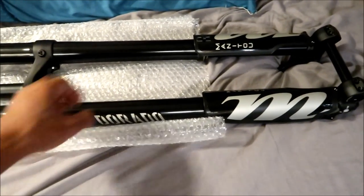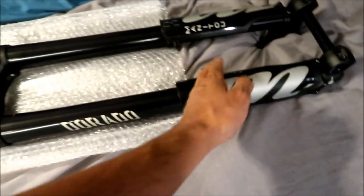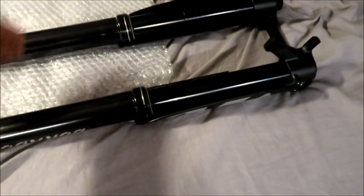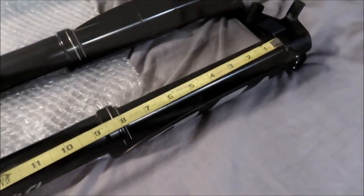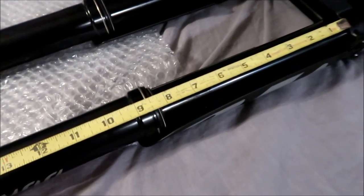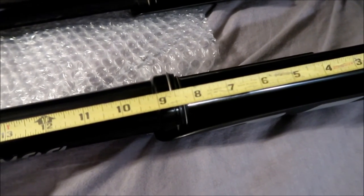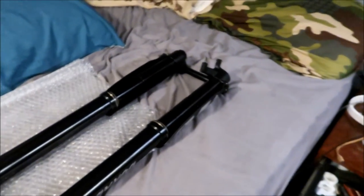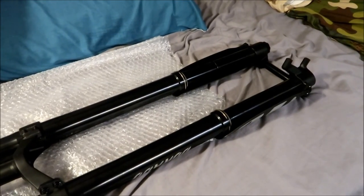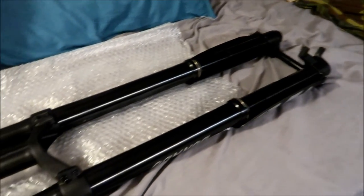I will let you guys know how the install goes. When I get the RST fork out, we can compare this to the RST fork. I'll tell you this — this is much beefier than the RST fork. It looks like the forks on my KLX 140, it looks like a motorcycle fork. These stanchion guards should do their job and protect the stanchions — that's why I went with the upside-down fork. There can't be any kind of low fender or fender brace that goes here because the guards will move up with the fork. It's roughly eight and a quarter inches of travel. I think dirt bikes with really good suspension have about 10 inches of travel — so this is eight and a quarter.